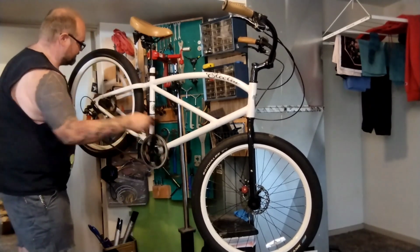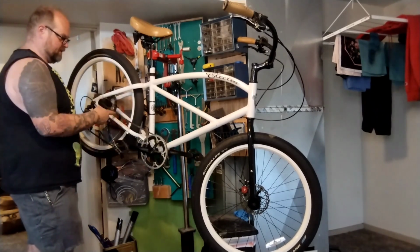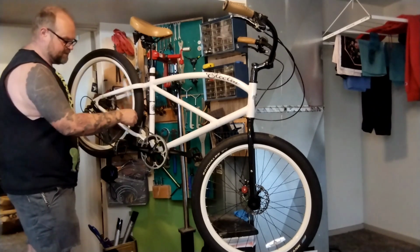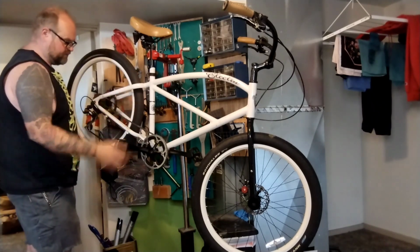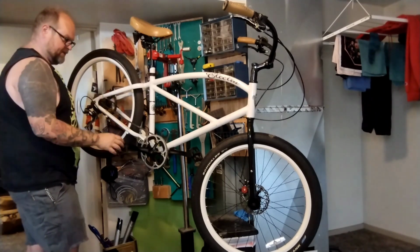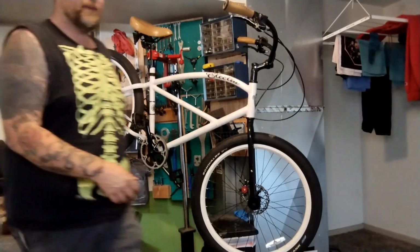Do some back pedaling still. I want to do 30 seconds or a minute of this to really let that lube work down inside the pivots of the chain. You do not want lube on the outside of the chain. It's a myth. That attracts dirt and grime. Dirt and grime is liquid sandpaper. It'll just wear out all your teeth and cogs. You just want to get down inside those pivots and wipe off the outside.